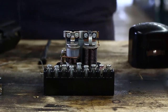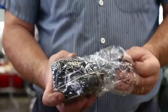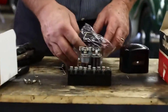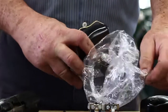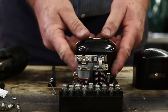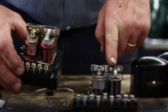Rather than repair this, we get the new unbranded control box. Remember all those unbranded products from years ago? This is a 5-post control box — it doesn't even say Lucas on it. It comes packed with a little bag of silica gel to keep it from getting too damp. But look, it's the same thing. We're going to take the guts out of this and put them into here.